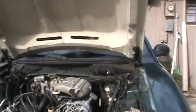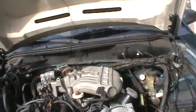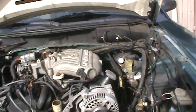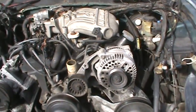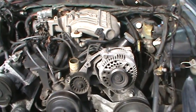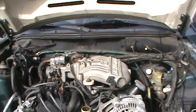That's one thing you gotta do is unbolt that shifter, the 4 bolts off top of the tranny. Okay. And drain the tranny oil out, because when we hoist it out of there, it'll be going everywhere. So anyway, we're gonna get the 2004 around here after we get this stripped. We're gonna get this off to the junkyard.